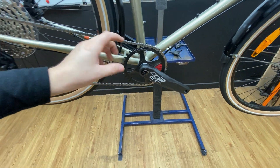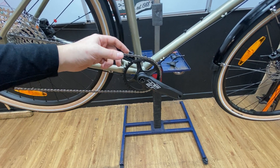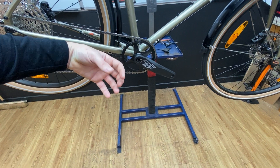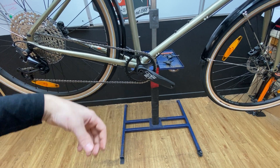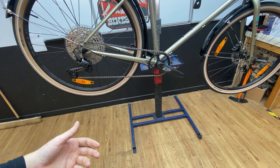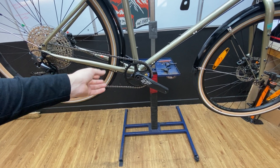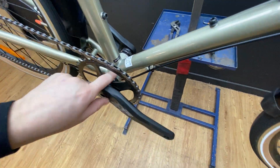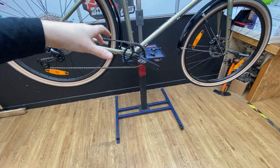The steel chainring on the front is quite good — it uses fat-thin tooth technology. Alloy chain rings wear out really fast; we see guys going through a couple a year on mountain bikes, whereas the steel ring lasts a long time. You can also change this chainring out and bolt a different one on, though you'll need a local bike shop as it has a special spline on the FSA crank to undo the nut. A bigger chainring means faster speed, smaller means lower speed — most customers go towards 40 or 42 tooth. It has a threaded BSA bottom bracket in the steel frame, compatible with any crankset, very similar to Shimano's Hollowtech system.